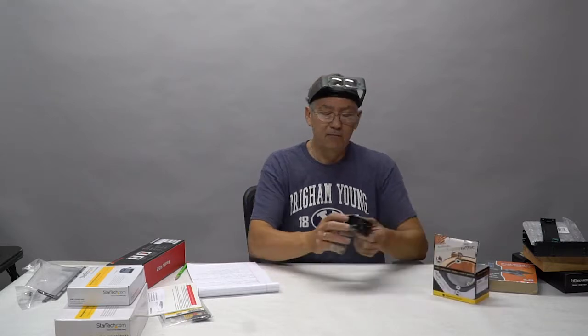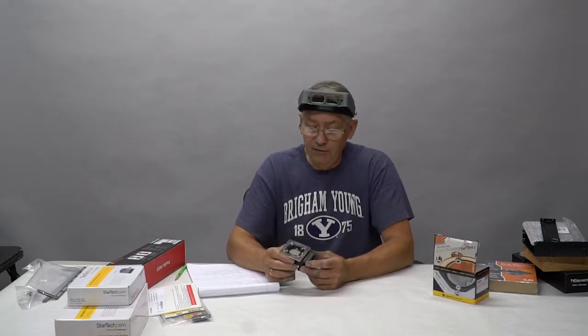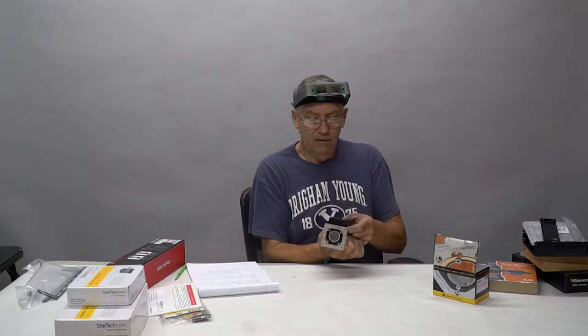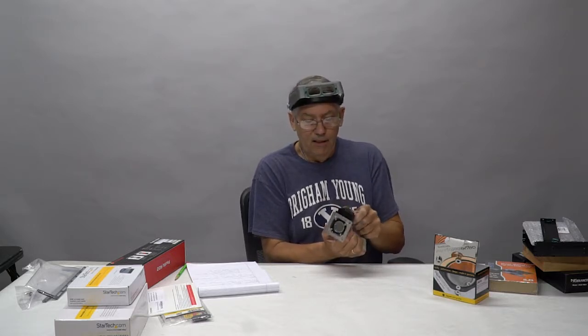So here's this beautiful filter by Aqua Computer. It's made in Germany. It has 2 valves in here so that we can turn off the in and out or turn them back on. So this way you can service this filter by turning these off. You can remove the glass cover, not plastic, remove the screen, clean it, put it back, and then turn your system back on.